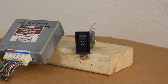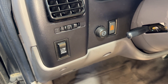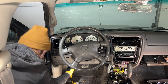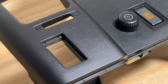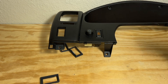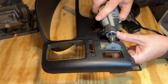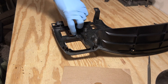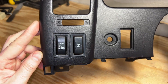The multi-mode T-case does not operate on voice commands, so we're going to need a switch to tell it to either lock or unlock the center differential. I considered two locations: one right next to the steering column and one next to the ECT switch. I like the latter better — the switch is more visible and easier to get to. I noticed all the OEM switches sit flush with the surface they're mounted to, so it'll take additional effort to get that factory-installed look. The switch essentially snaps into a countersunk hole. I printed a cutting template that references the adjacent hole to ensure the switch is located correctly and looks square. After absurd amounts of sanding and filing, I glued the switch mount in place with a two-part epoxy. Overall it mounted in very nicely, and from more than two feet away you might be tricked into thinking it was factory installed. Switch installed.